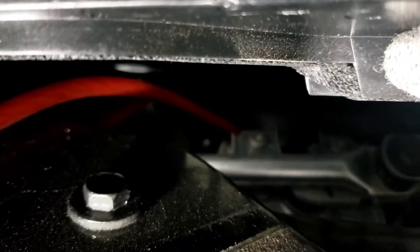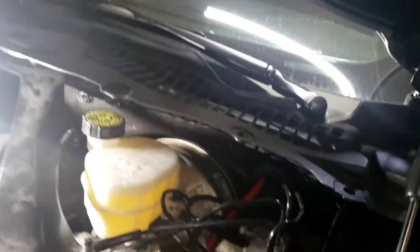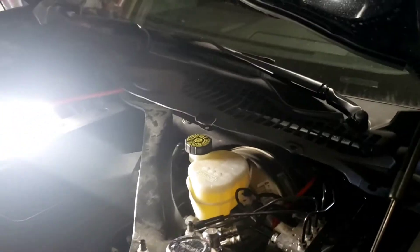Running through here is too much work, and I can see that the windshield wiper motor and everything is right there — that's too much of a fire hazard risk. So I'm going to pull it back out and run it through here with a wire loom instead.